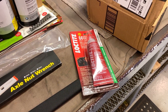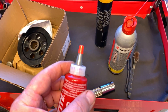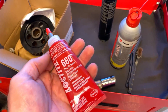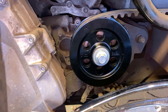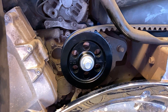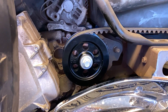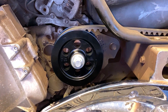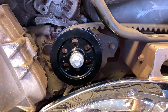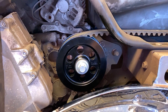This stuff is supposed to be the bee's knees if you have an ever-so-slightly loose fitment between your shaft and your new front pulley on the Spyder. It works slick. For some reason I thought it was going to be red — I've got some anaerobic sealer in a bottle very similar to this — but it's a kind of metal-flaky gray. There she is, all bolted up, torqued down to 150 newton meters, which is about 110 foot-pounds.